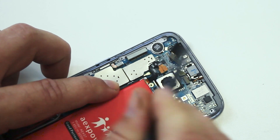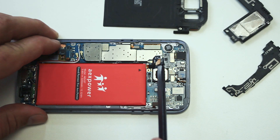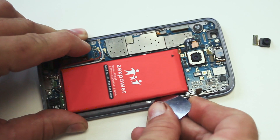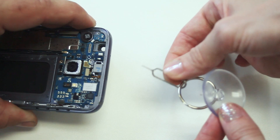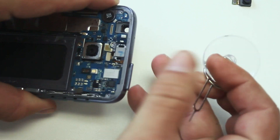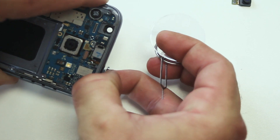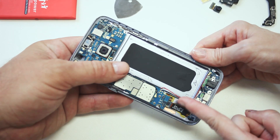Remove the camera. Unhook the battery — in this case, you just pull up on the orange tab, then take the entire battery out of the cell phone. Next, remove the SIM card tray using the removal tool. Now the motherboard should come out, unless you forgot a connector.